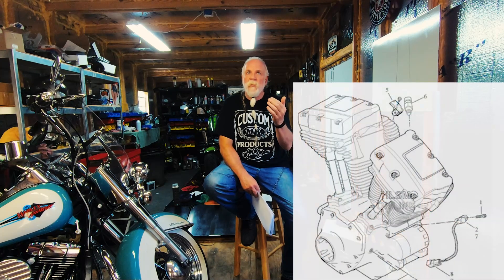It's the twin cam and the Milwaukee 8 that have the serious problems. So let's talk about the twin cam first. Our target temperature for the twin cam is 230 — we don't want to go above 230. That's the ET readout coming from the sensor located at the rear of the front cylinder. We want to see a temperature of 230 or lower. Ideally we'd like to see 190, 200, 210, but the fact of the matter is that's unrealistic. 230 is okay.